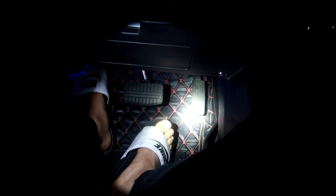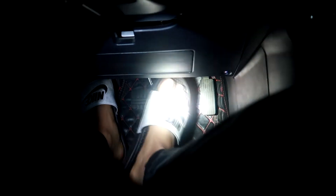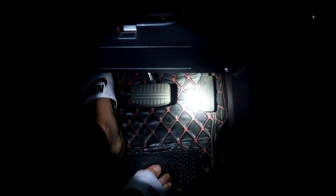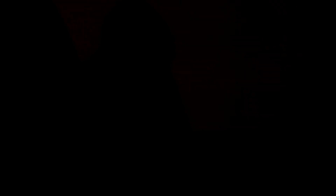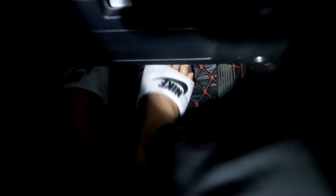Inside, trying to pump the brakes. Manny says to pump it three times and hold — let it compress all the way to the floor. We're making sure there's no air the old school way. The new school way is a brake bleeder, way quicker. All the way to the floor, back up, floor, back up, hold — pump it three times, hold. Brake pumping is pretty much done.